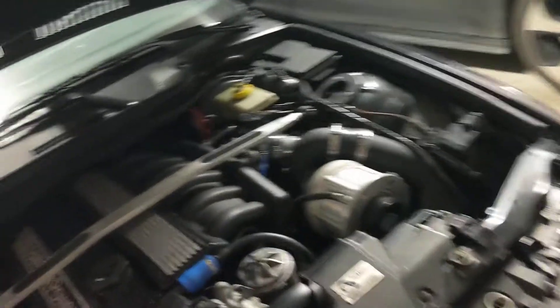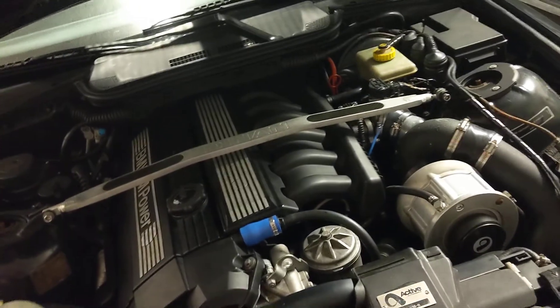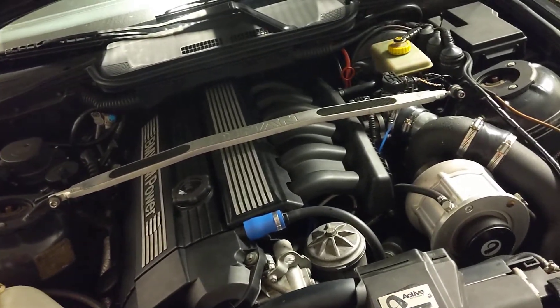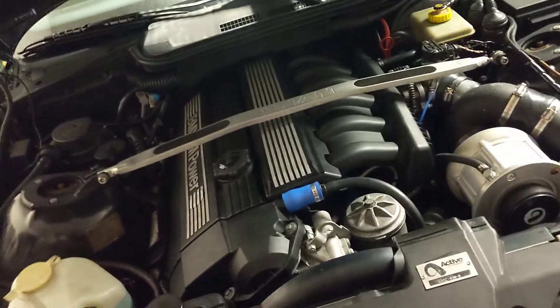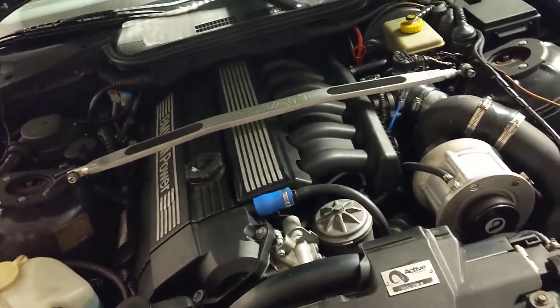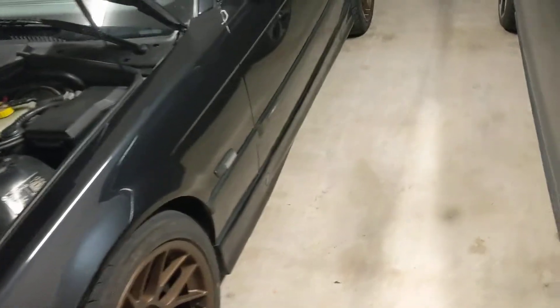The car is running good now. I just autocrossed it yesterday and it ran fine. It does have a lot of lifter tick — I don't think I overfilled the oil enough — because after the first run it was really noisy. I quickly Googled and it seemed pretty normal after autocross. Next time I'll overfill the engine a bit and hopefully that helps.